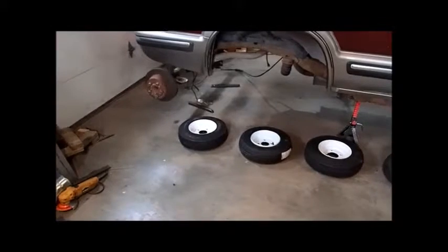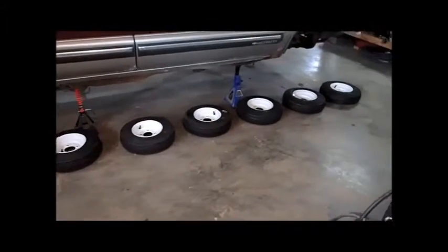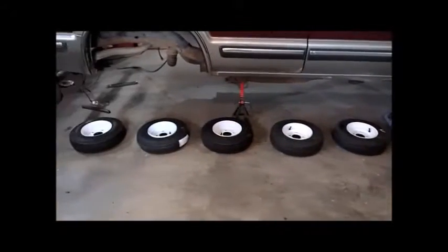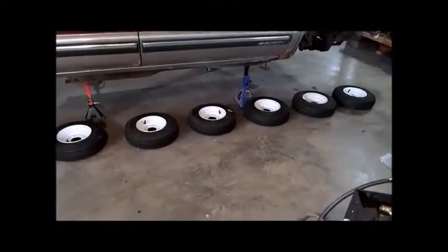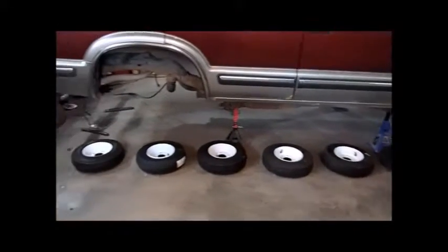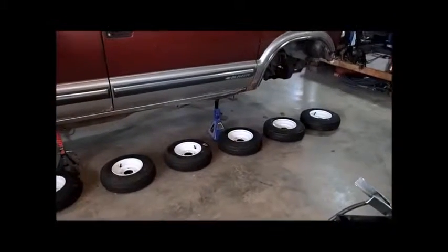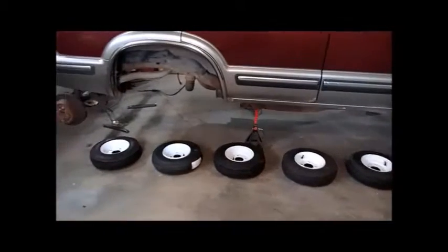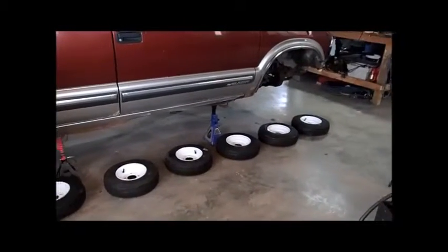Each tire is rated for 600 pounds, so each pair is rated for 1,200 pounds. Front and back — or left and right — the two fronts would be 2,400 and the rear two would be 2,400. So as long as the weight is spread over two mounting points, it'll be 4,800 pounds rated. The vehicle was 3,600 pounds stock, and with what we've ripped off it's probably a fair bit lighter. But it still may be an issue without a double walking beam, because you can be at points where you'll pivot on just two sets — one set on the left and one on the right — and that might be too much for the tires.